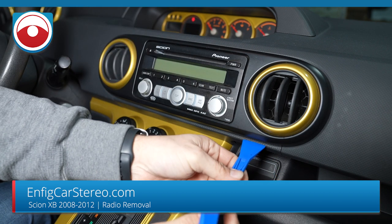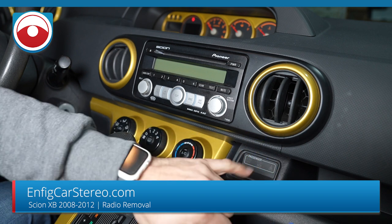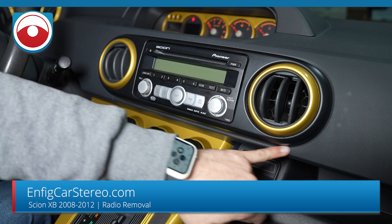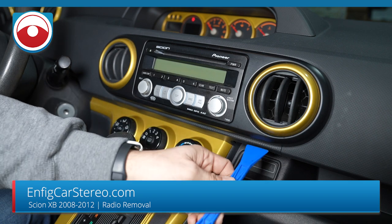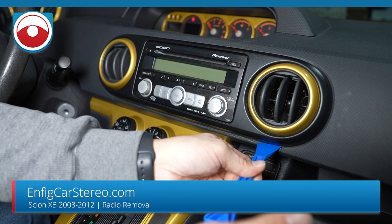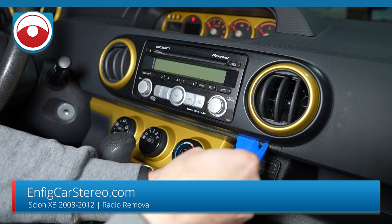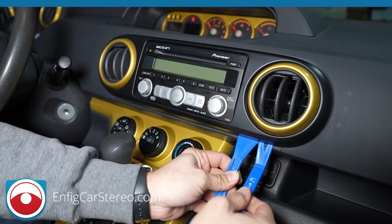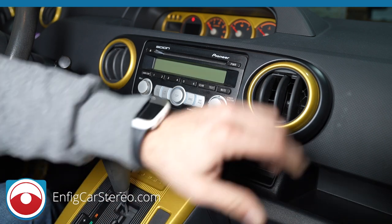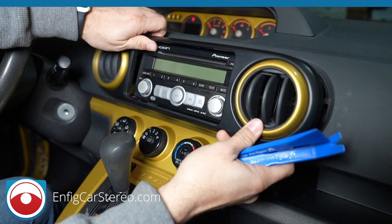This car is in pretty good shape, so I'm going to grab the PPT2 and just jam it in there. I'm going to use this area here because this is a removable piece — if you scratch this up you can always buy a new one — and then this is part of the dash. You're going to go in there, gap it a little bit, come out with the second one, and pry. Once you get that one out you can pretty much just pull all over.